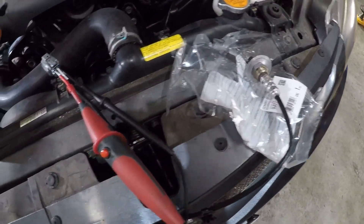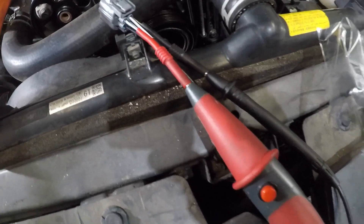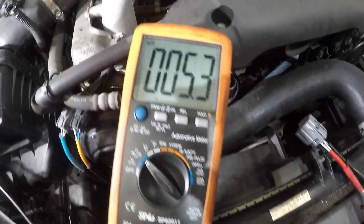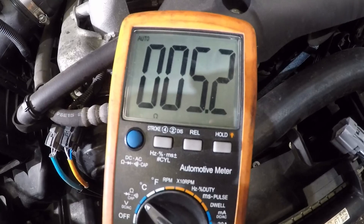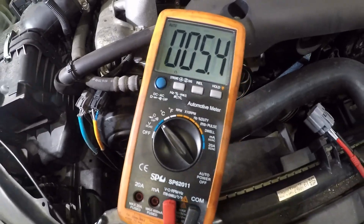The brand new sensor has arrived. I've back probed it - the flat terminals and flat probe ends make it straightforward. Check it out: hovering between 5 and 5.5 ohms. We know that's definitely the cause.